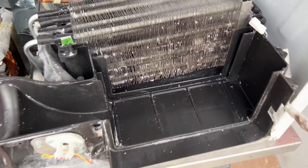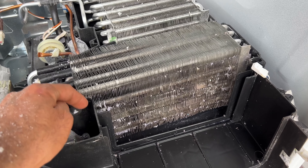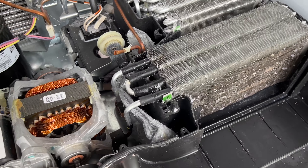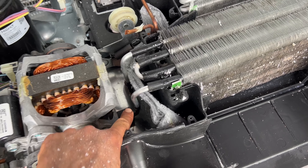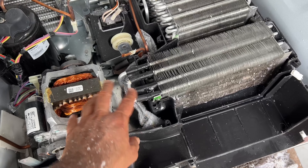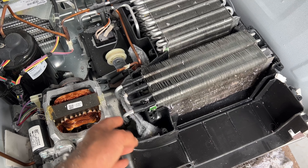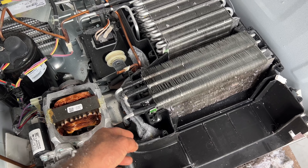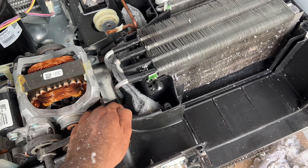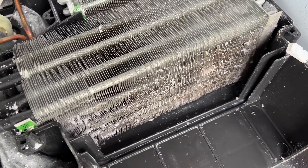Looks really good compared to before. You will never get it 100% — some debris is stuck on the sides which is almost impossible to clean unless you cut the high side copper line. But it's a refrigeration sealed system — you don't want to go that deep. If you're a technician in your own place and you know refrigeration, I would advise you to cut the pipe, vacuum and reclaim all the refrigerant, resolder it, rinse it with water, and then charge it. But I don't think you have to go that deep — the dryer is going to work perfectly fine.